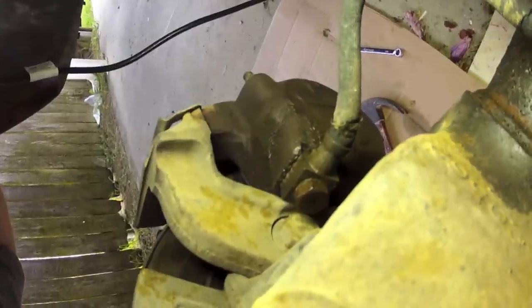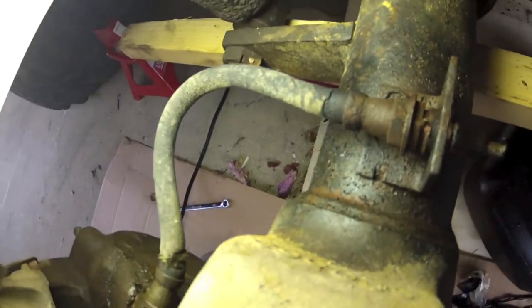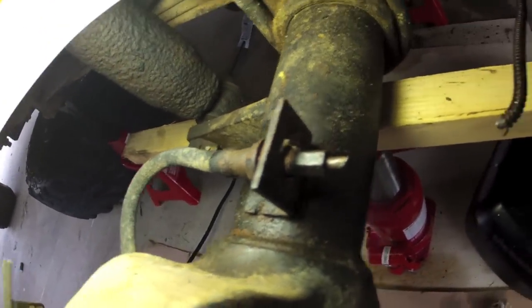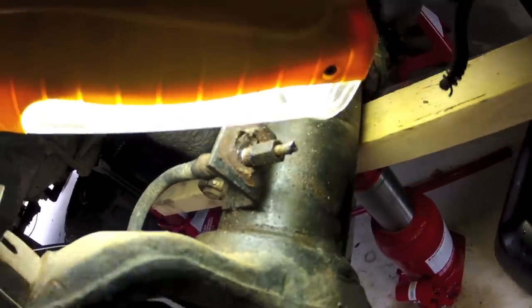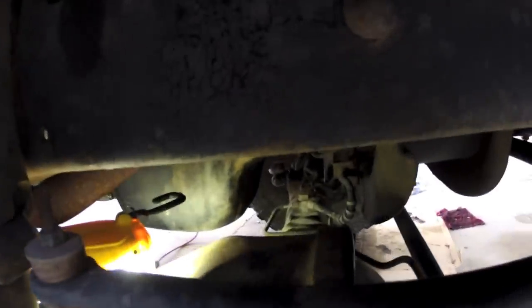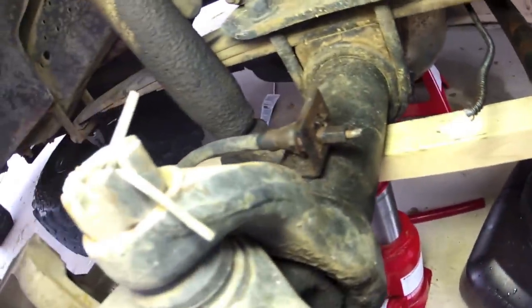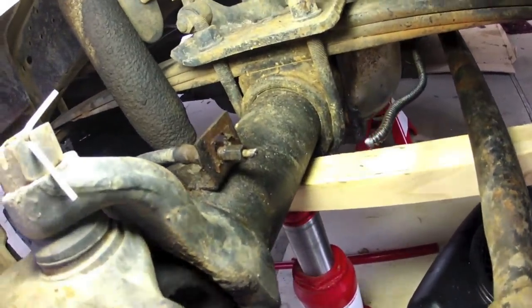You can see the outer shell has been worn and broken through — that's the reason I was changing them out. What I was doing was unscrewing the hard line from the soft line, and this piece right here is supposed to rotate on itself — well it didn't, and I broke my hard line. So now what I'm doing is changing out the hard line which attaches down there, comes around, is held by this clip right there, and ties in right here.